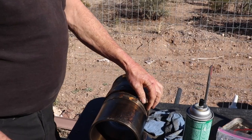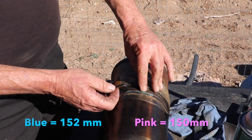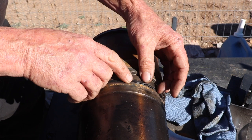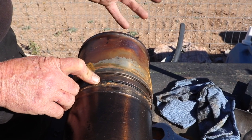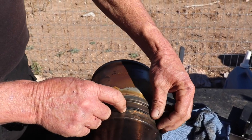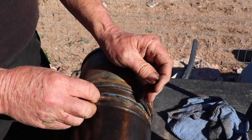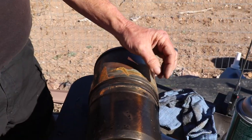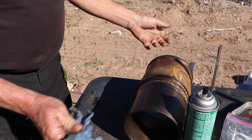There's an easier way — if you've got 152s, you're going to have a green or bluish indicator mark on the gasket itself. Now, this was something else I was worried about: even with the overheating, even if the liner protrusion was right, I still worried about these o-rings — maybe they got fried inside that block. You could kind of see how chewed up they were inside of there. I don't know if they would have leaked, but why take a chance when you're putting that much money into an engine? Anyway, we've got it all figured out — we know what size liners we need and we'll get it done.